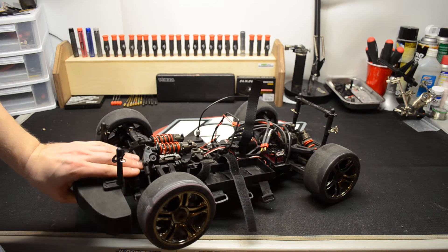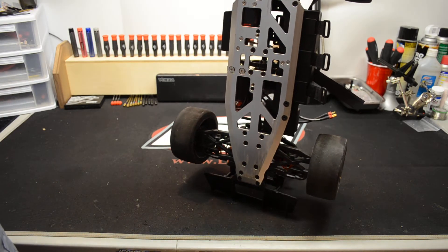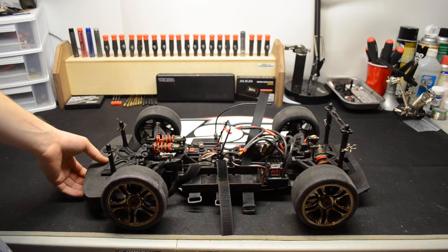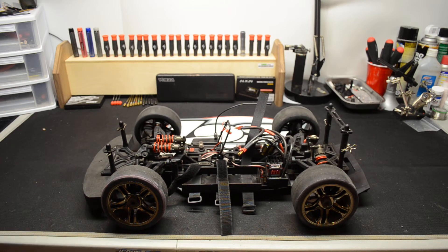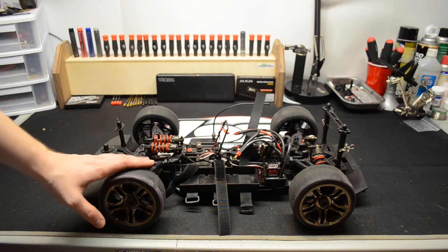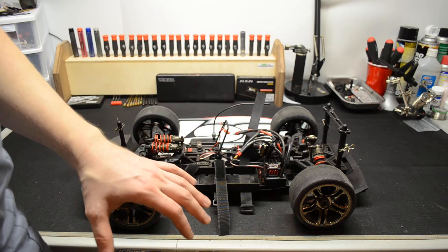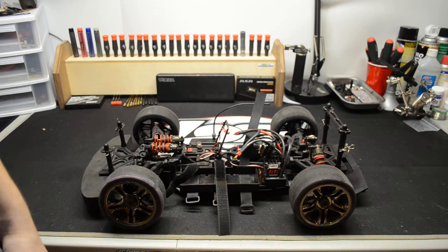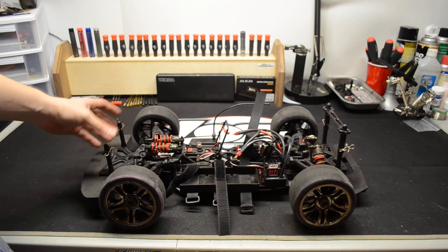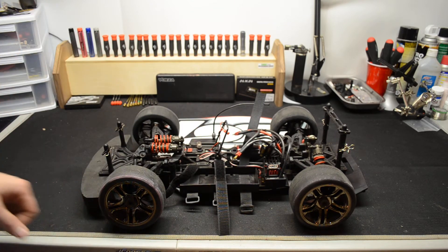It has been verified with a real radar gun. It's quick — it's fast. I only get about seven to ten minutes of runtime on two 5,000mAh 3S packs running in 6S. I don't recommend running it on 6S, but it does get very, very hot. I run it for only about three-minute increments because it gets pretty hot pretty quickly. I haven't burned up any motors or speed controls at all — knock on wood.